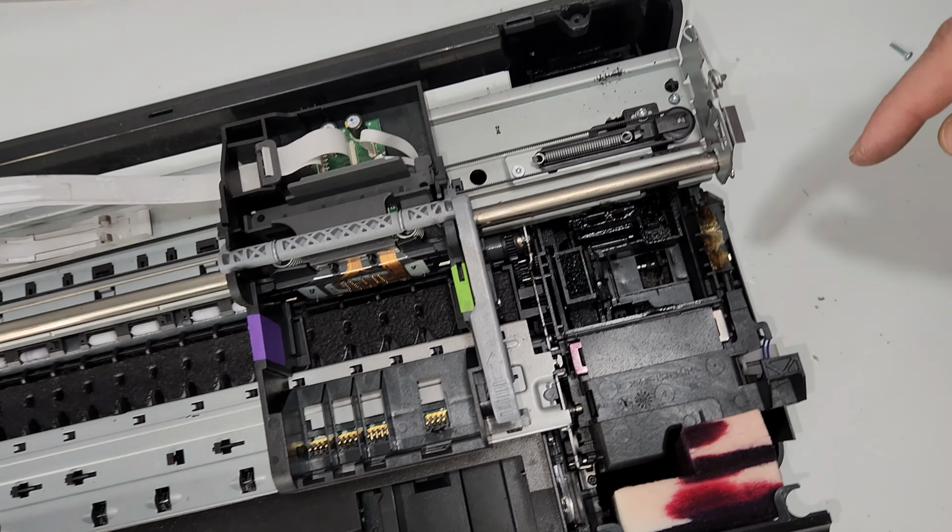And then this is where our main board is. So to remove the main board, you really don't need to remove anything here. You can just unscrew some screws over there and get this out. So basically what we need to do is, I would remove the wires first, disconnect them I mean, very carefully because sometimes the ports will slide out. I'm going to remove this plastic piece right here to get us a better access and a view. So that comes out.